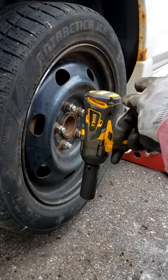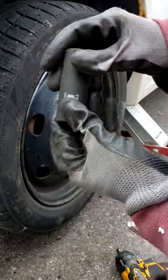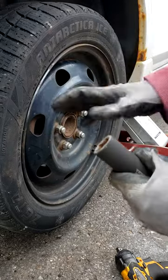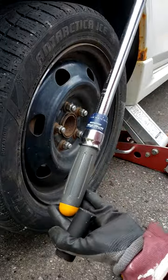But I'm going to use it today. What you're going to need is the impact socket that fits your lug nuts — this one's a 21, this is a Mazda lug nut — and you're going to need a torque wrench. That's the most important part of this whole thing.